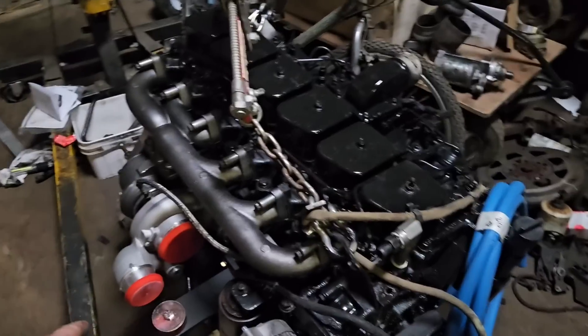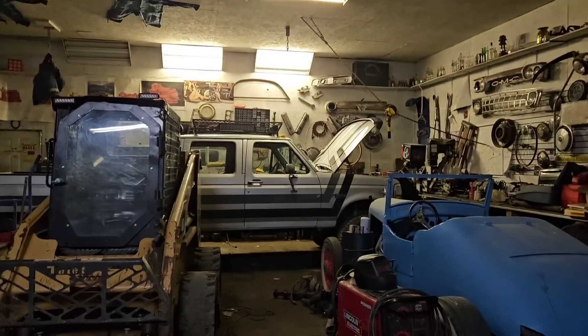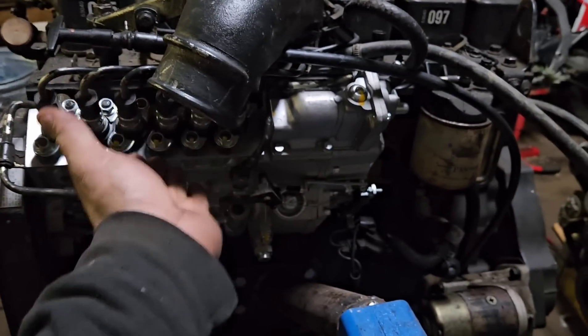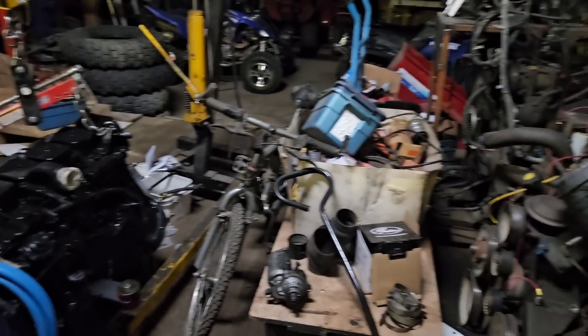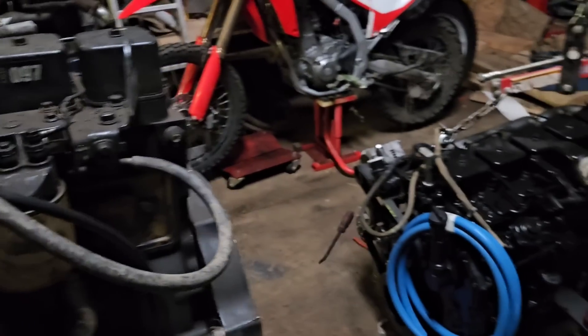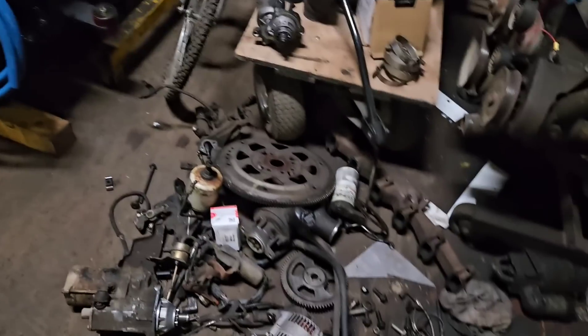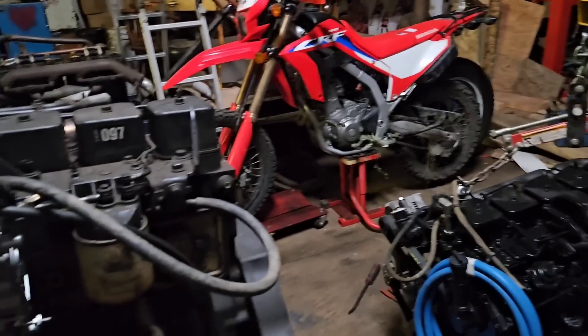You're also going to have to build your intercooler piping to the intercooler. There's no way around this. I've already built one of the pipes — the one that goes from here to there — because I measured off that truck. But it doesn't work for my particular conversion because that truck is a P-pump, so the inlet to the engine is different. I can't build that one ahead of time; I have to build it in the truck. I kept all the old parts from the swap, so I have the parts. In the end, you're going to be left over with a bunch of parts you can't use. But if you're lucky, maybe you can recoup some of your money online with Craigslist in the States or Kijiji in Canada.